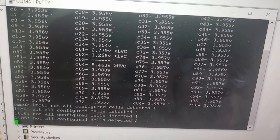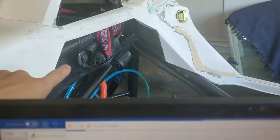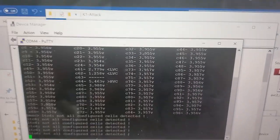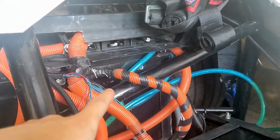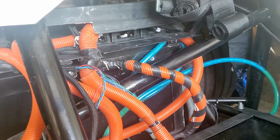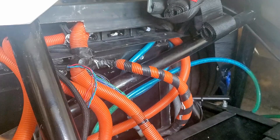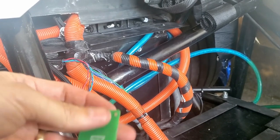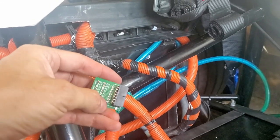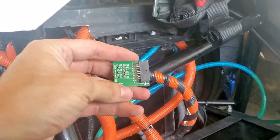And so that's what I'm confused about, because that's an LTC6, and I unplugged LTC6, and all the voltages showed good. So I'm thinking it might be that satellite. Okay, so for the BMS units here, I was reading cells 61 through 64 that are not good, and that's in, they call it LTC6, so essentially my sixth over there. And I pull it out, and they've got this little circuit board thing that you can kind of read the cells individually. So my battery modules themselves are reading good, meaning the wires, everything up to the LTC is reading good.